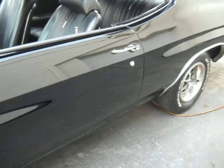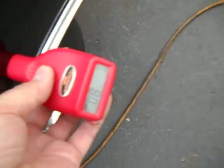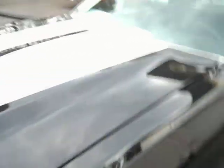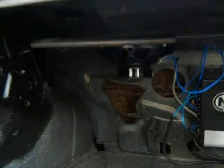We ran a digital paint gauge around it to assess the quality and how thick the paint is. We're getting readings — 10.0, 8.0 — the readings run anywhere from 5 to 25 all around the car. Anything under 30 is acceptable. 3.5 mils on this gauge is equal to the thickness of a dollar bill. I left the trunk open — somebody did a nice job of putting this back together. I don't detect a pan change, I don't detect any quarter panel overlaps up there. If the quarters were changed, which they were likely done, they did them in the full quarter fashion all the way through.